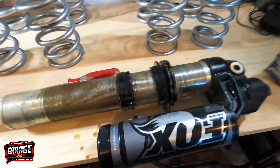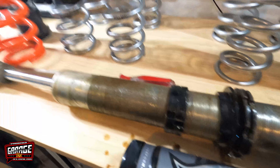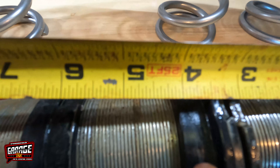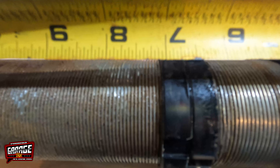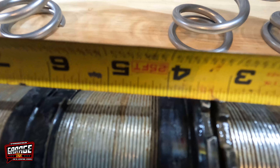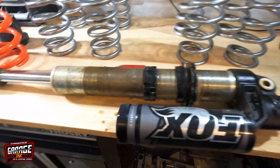All right, so we got it together here. Let me pull out this handy dandy tape measure. You got three and a half inches to this bottom cup, and then the bottom of your collar should be at seven. Had to wash it — as you can see it's still a little wet, had some mud built up on it — but we got it set up and we're gonna drop it back in the spring compressor and drop those new springs on.